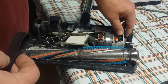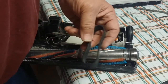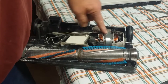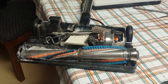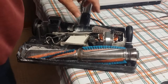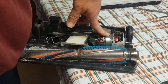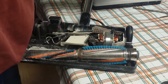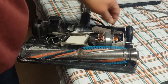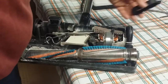Heat is a bad thing for these little motors. So if this belt is starting to slip on you, for four bucks get it out of there, get a new one in, and save yourself — I don't know what that motor's worth, probably a hundred bucks. If you want to save yourself the expense of putting a new motor in or rebuilding it, just slip a new belt on here. Make sure you've got the right one.